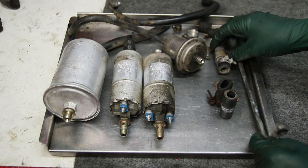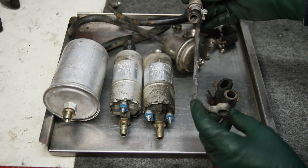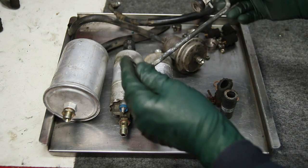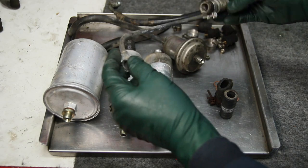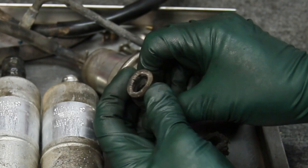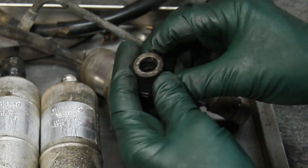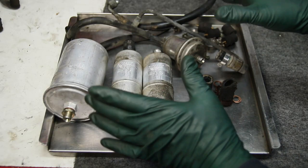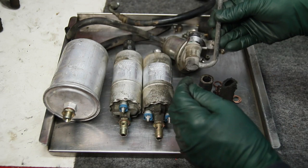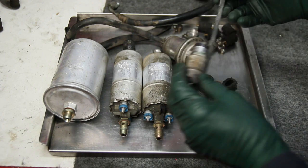I don't think some of these fuel hoses are okay — particularly this one. This is the connection between the two fuel pumps; there's a little short hose on here and you might look at that and say 'oh this is an expensive part, I don't want to replace this.' But look at what came off mine — a 93,000-mile car and look at the cracking on this hose. So it's better if you're going to mess with this fuel delivery system to change every single fuel hose. I show you in the kit how to replace this hose without having to buy a whole new $50 part.